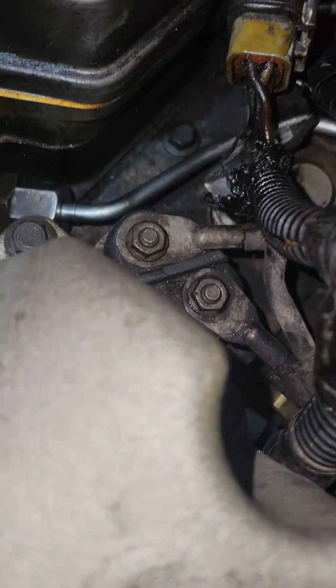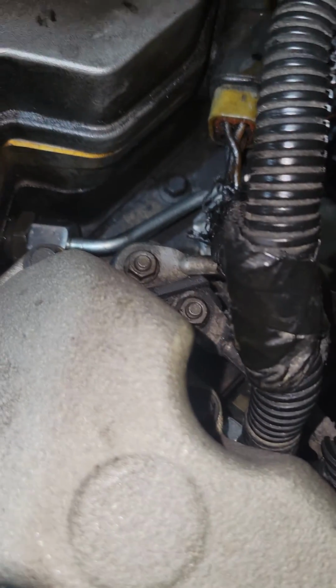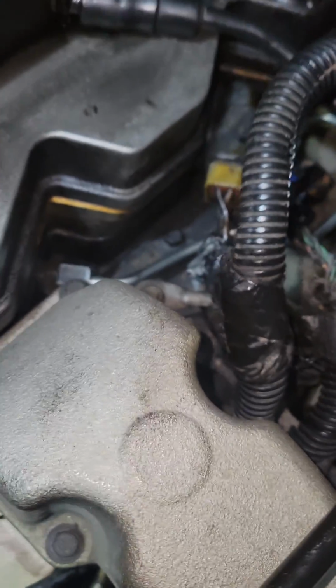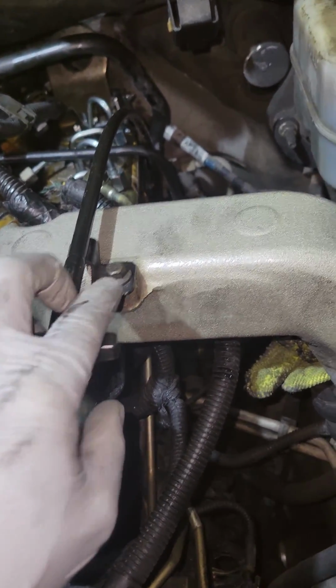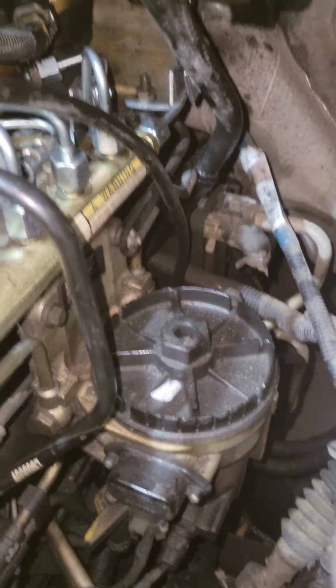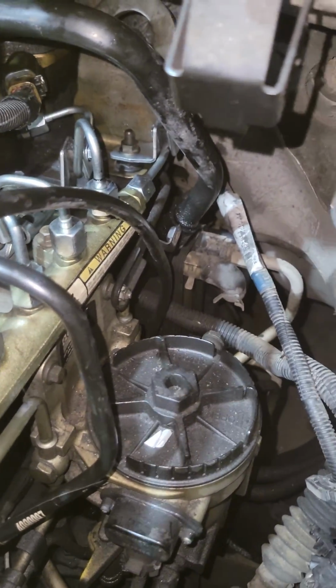Also, air heater grid nuts go at 89 inch-pounds. It's about 8 foot-pounds or so. Don't break those off either. You'll be buying a new air heater grid there. So, okay, also 18 foot-pounds. And don't forget that you have a stud over there with a nut. And then there's the clamps to put it all back together. And then you're just going to install the boost hose.